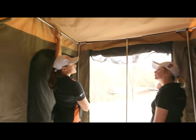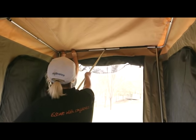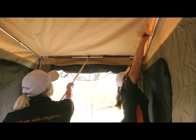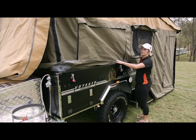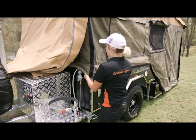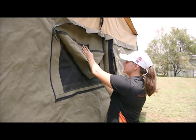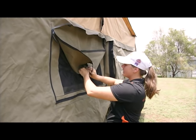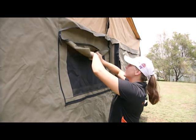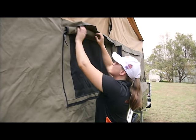Make sure the wing nuts here are quite loose and then push this out a little bit as well. Tighten those ones off. Now to tidy up, all you have to do is pull your canvas over. On the back of the camper you've got two different styles of windows. A nice tip when you're on your own: fold everything into a triangle, flip up the end part — it's going to be easier to roll and you're not going to have so much canvas in the little areas where you're hooking it over. Keep it nice and tight so the bulk of your canvas is in that center part.